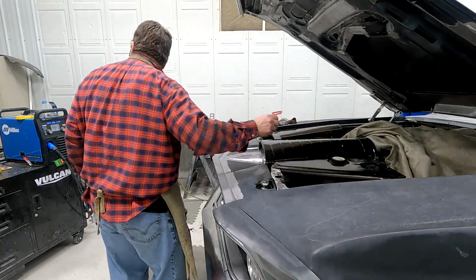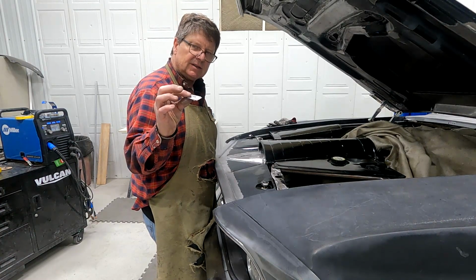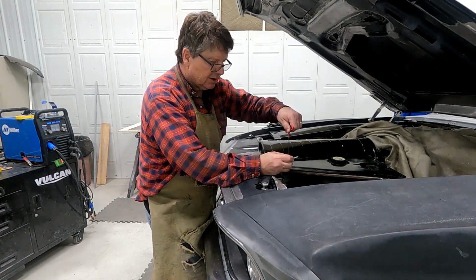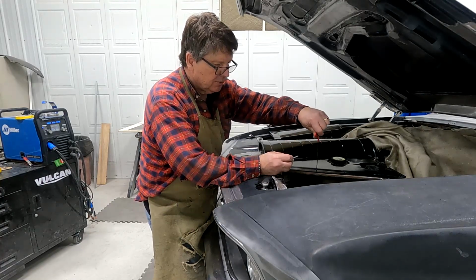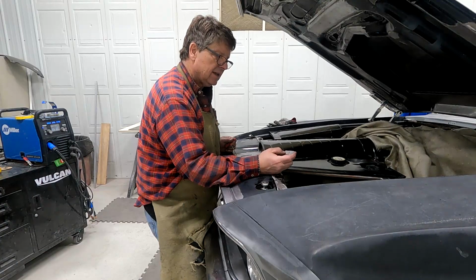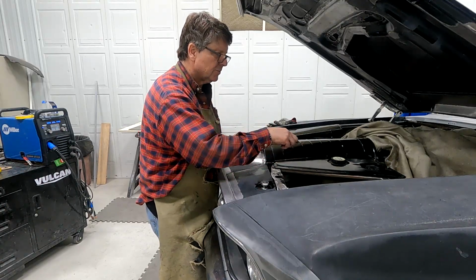They slide around. I put them on a piece of stainless steel. Put a rib nut in, and then that sits inside a channel, and it will slide back and forth to allow you to align your holes. There's plenty of room in there. They move back and forth. Otherwise, if you didn't have some kind of an adjustment, I think it'd be really hard to get all your screws to line up perfectly, because you need to move your panels around a little bit, and there's so many screws there.